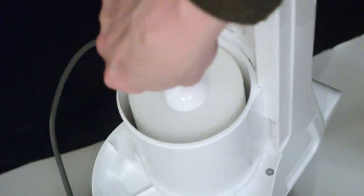This is the foam filter, the filter frame, and underneath you'll find a felt filter. To clean your filters, the pre-motor foam and felt filters, with the dust cup removed, take out the foam and felt filters and rinse with water. Tap loose dirt off filters between washes as needed.